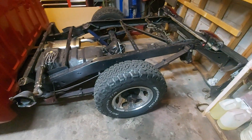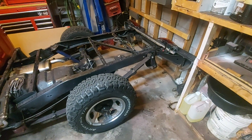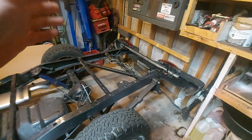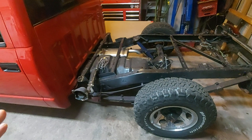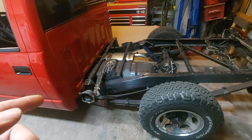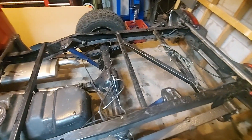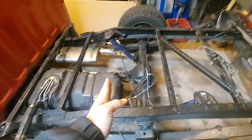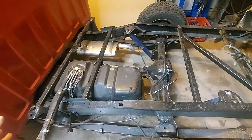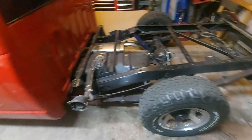Other things you run into: I didn't want the spare tire mount — it probably would have fit, I just didn't want it. I used some box tubing to strengthen it. Gas tank mounts do not fit from the long box — the tank has to move forward or it would hit the axle. This used to be mounted further back; you have to shove it forward but the mounts don't work. You could get short box gas tank mounts; I didn't — I just made my own.